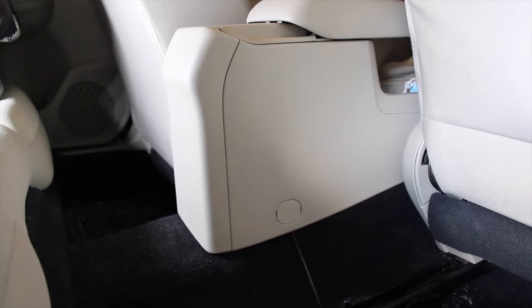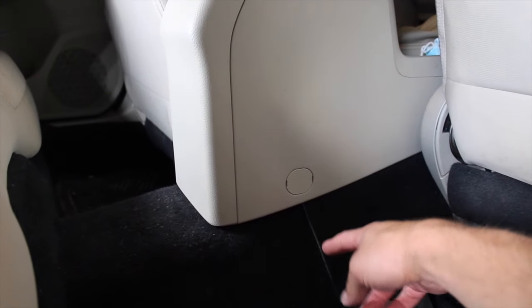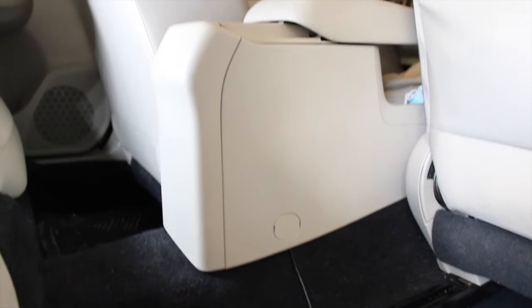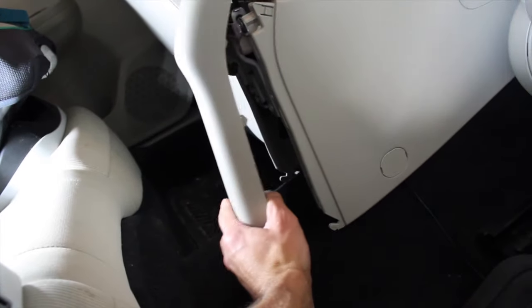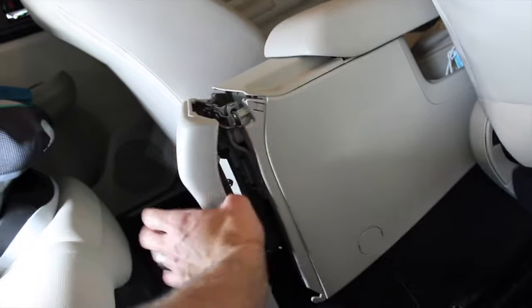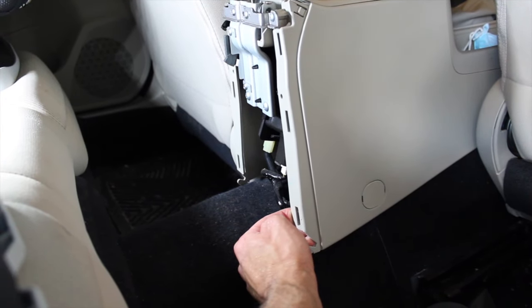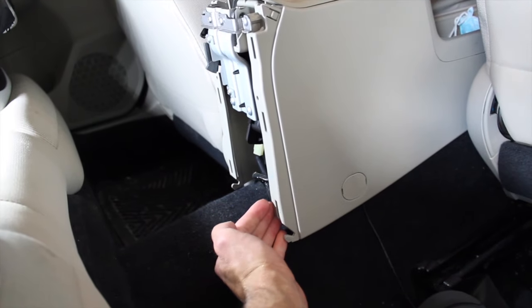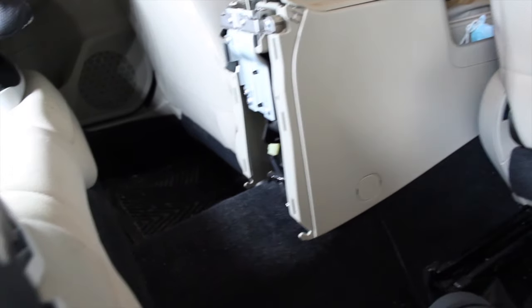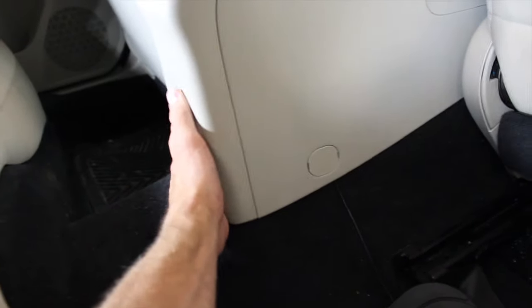This is the back part of the center console with the front seat moved up all the way. The easiest way to get back here — there's a little access hole, but I didn't want the wire coming out of that because it would look weird. Instead, you can move the seat forward, pull from the bottom, and this whole back panel pops off really easily. It just has a few tabs and snaps. Once it's off, you can pull it out a little to access underneath more easily. I pushed the USB extender part up through the hole in the center console from the back. It snaps back on fairly easily by just lining up the holes and pushing it back on.